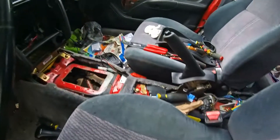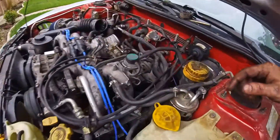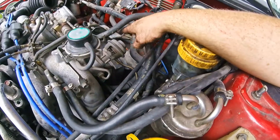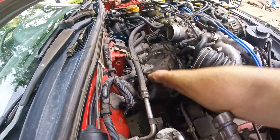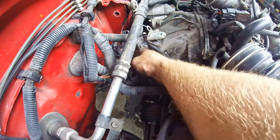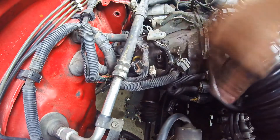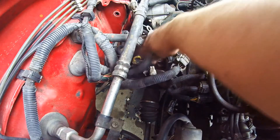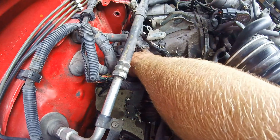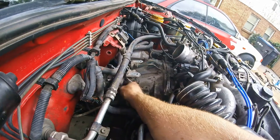Now you've got a big hole and we are ready to disconnect the rest of everything down below and drop that transmission. We have three bolts left - the bottom bolt on the starter and the two studs, just nuts we pull off. And then that big connector right here. We also need to unplug this guy. That stuff is bolted to the engine. You can unbolt that flange down there, or just pop it off like that, and let it hang.